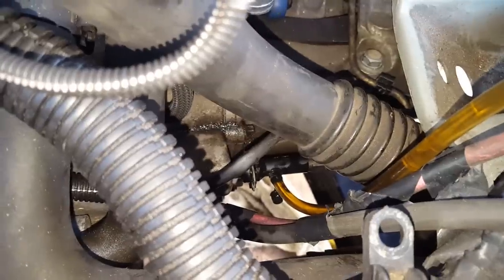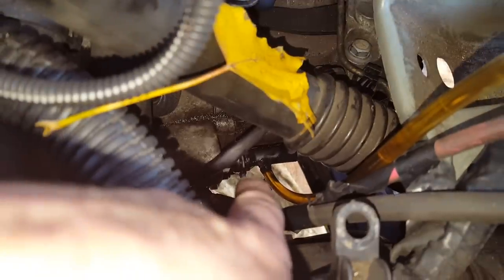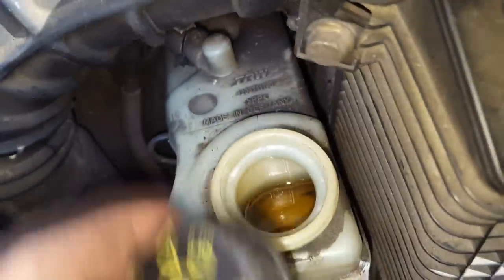This is how to bleed the clutch, the tube on top. Well, you want that this is not completely on, at least I've seen that. And when you attach this one, then you start to fill with the brake fluid. As well, make sure that your brake fluid level is over the top, so there is a lot of brake fluid in. So when it starts to fill in, first, if there is no brake fluid in the line to the connector, make sure that you press the pedal a few times. Maybe that will make sure that some brake fluid will start to move in and out.